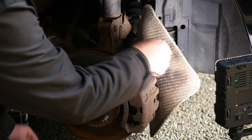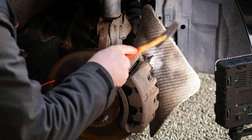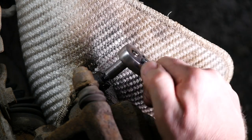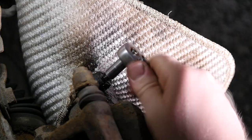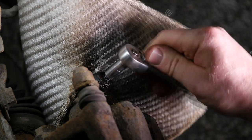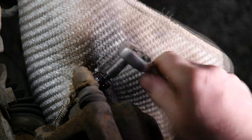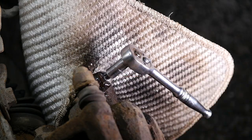You can just tell it's not going to move. You know when you think they're only tightened up to under 10 newton metres — that's not a lot, so it shouldn't take a lot of torque to undo it. Then there's a slight bit of movement — a very tiny bit of movement. Once you've got that tiny bit of movement, all you've got to do is just keep playing with it, work it back and forward bit by bit, until it goes further and further around. Keep it well lubricated with penetrating fluid and just keep going back and forth, and then hopefully it will just keep coming undone. And the fourth one is a success story as well — good news.